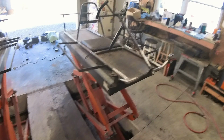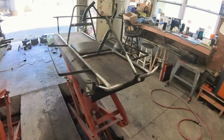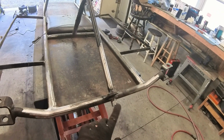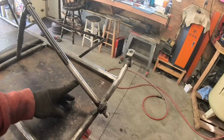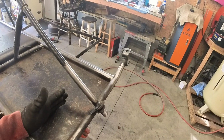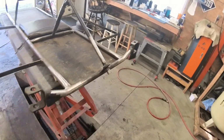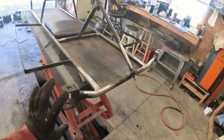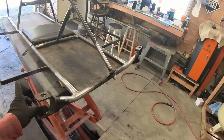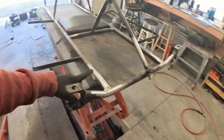So this is the cart now, or the other cart. I'm gonna do the same thing to mine. This is hers. Cut the steering stop off, and I'm gonna re-weld it back here to move the steering behind the shaft, because our feet are gonna be up here. So hopefully that'll give us more room, and I'll just reverse the spindles left to right, right to left, so that the rest of the spindles back here and pivots this way.